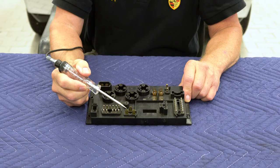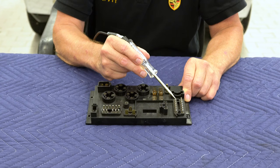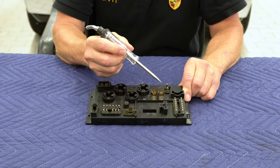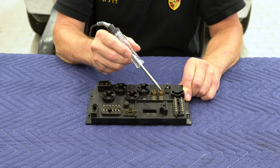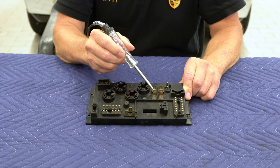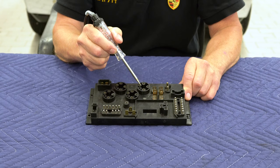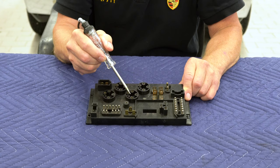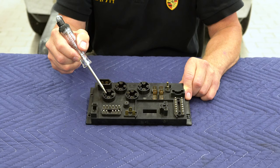These three pins are where the alternator plugs in to go into the regulator, which plugs in right here. This is the rear plug for the rear window defroster, which very few cars are equipped with. This is a dummy fuse block, which would be for Sport-O-Matic if so equipped — they only made about four Sport-O-Matics, so this was never really used. This is the fuse holder with a 25-amp fuse for the rear window defroster, the fuel pump, and the auxiliary air valve. This is the relay for the rear window defroster, the main power relay for the fuel injection, the auxiliary relay from the fuel injection for only the fuel pump, and the rear window defroster relay — the rearmost in the relay board.